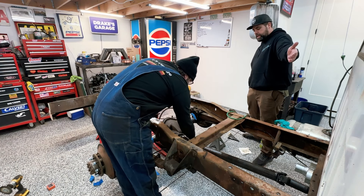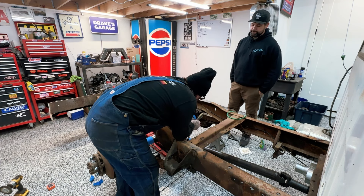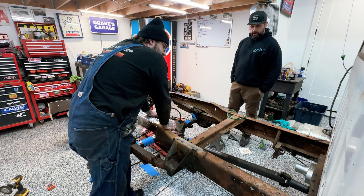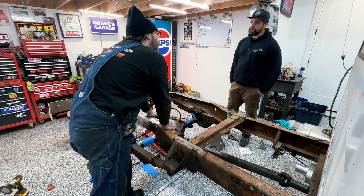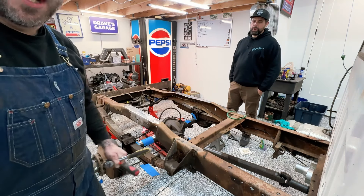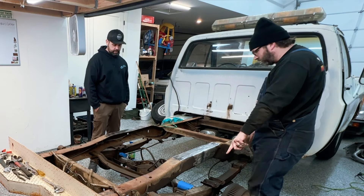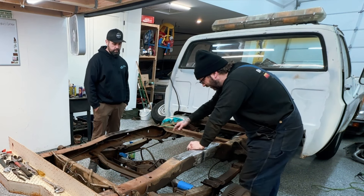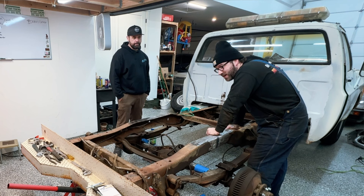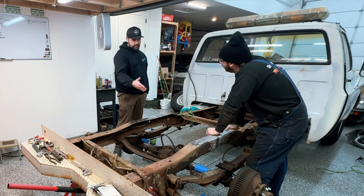Let's remove the drive shaft. The viewers are going to think you did this in probably like 14, 15 minutes total. Now we're moving the drive shaft because we've got to lift this thing way up in the air. Actually, I really don't need to remove the drive shaft — you could leave that connected. Scratch that, we're going to leave the drive shaft. Let's shut this off, act like it never happened. I say throw jack stands underneath it, start doing our U-bolts, and then put a piece of board to hold the differential up. We're not taking the drive shaft off, so we'll go ahead and remove the axle from the springs.